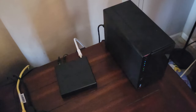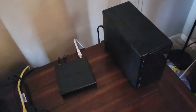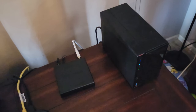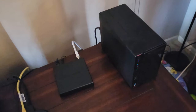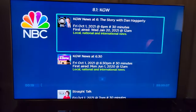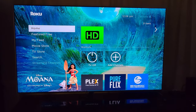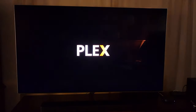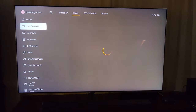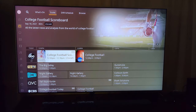I'm going to be using my NAS media Plex server instead, because it works rather well. The signal flow goes: antenna → HD HomeRun → network → NAS, and from the NAS to the TV and/or the Roku.